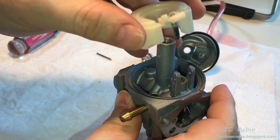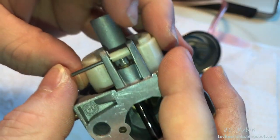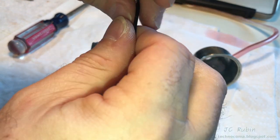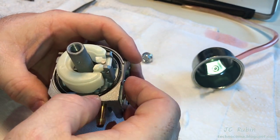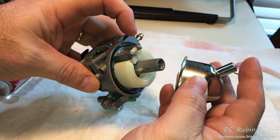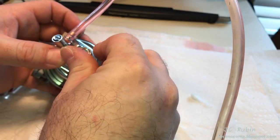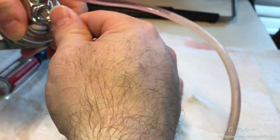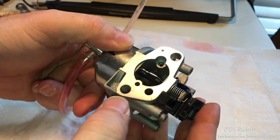Lay the float back over, putting the needle into the seat, then insert the pin straight through and centered. The O-ring should be on the carb body, not the bowl, so I've removed it and inspected it — it's fine. I lay it down on the carb body in that groove. Generally the pins will be aligned with the flat of the bowl, but may require a subtle adjustment so the drain screw is accessible when installed. Hand-turn the bowl bolt back in ensuring the washer is still on the bolt, then snug it down using the 10mm box end of the wrench — not too tight, just snug. That concludes the cleaning and inspection of this carburetor.